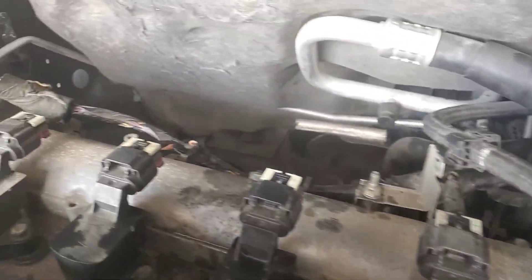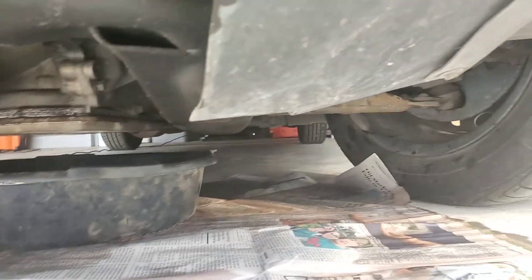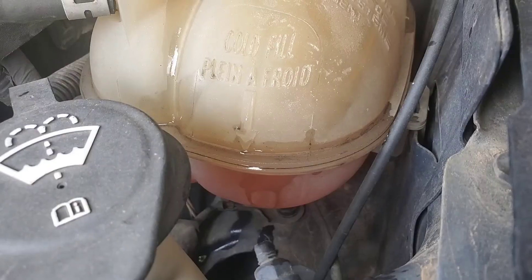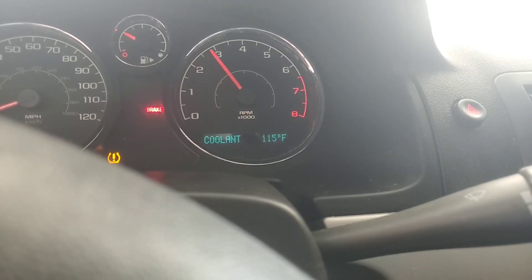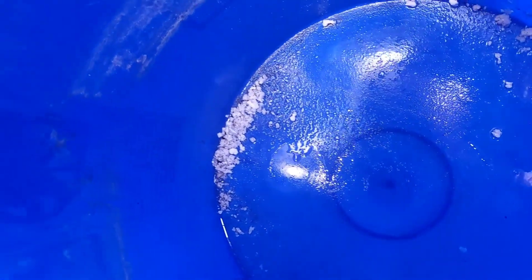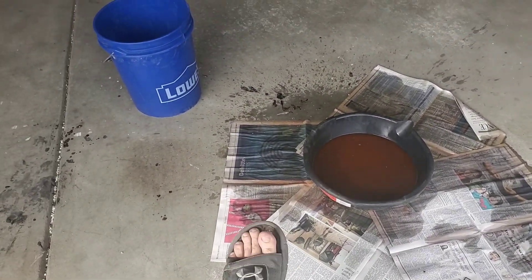Check for leaks — I don't see any leaks down there, none under there. That's a good sign. That level looks like it's perfect. Double-check coolant temperature, give her some more revs — really build that line pressure. If it's gonna leak, here you don't want to know. Cleaned out this bucket — look what I got. That all came from our heater core. That was clogged, and yeah, we made a pretty big mess. Good thing I wore my safety sandals.